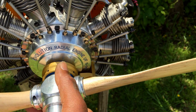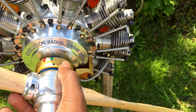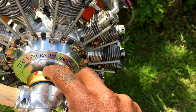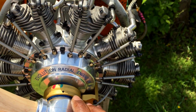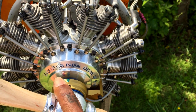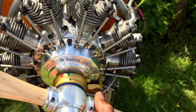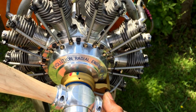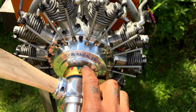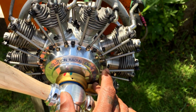You also rotate the magnet counterclockwise. The ring I send out will have a green and a red mark — the red one is to reset the software, the green one is the timing magnet. So you rotate it counterclockwise until it meets the sensor, and that's where your timing should be set — at 30 degrees before top dead center. You want the green indicator to stop just before it passes the sensor, not after.